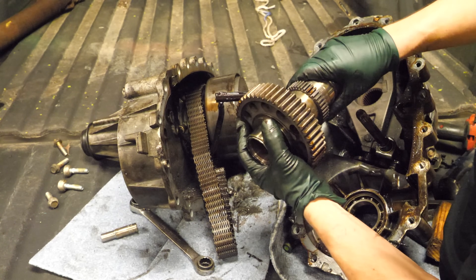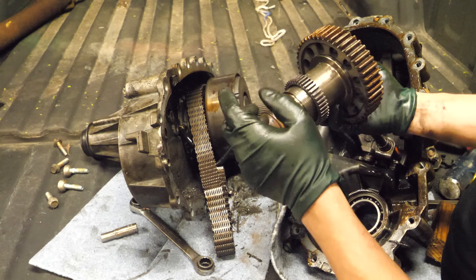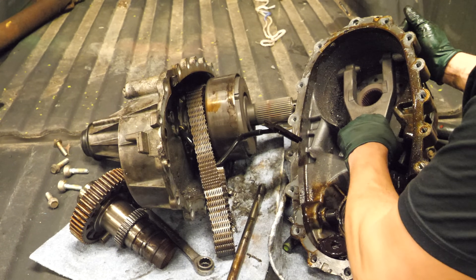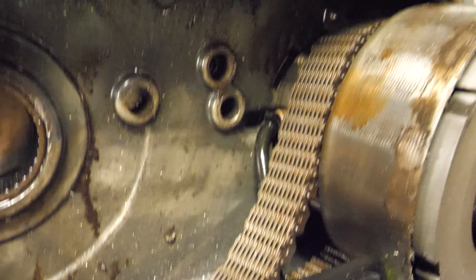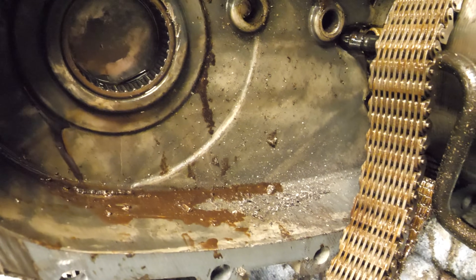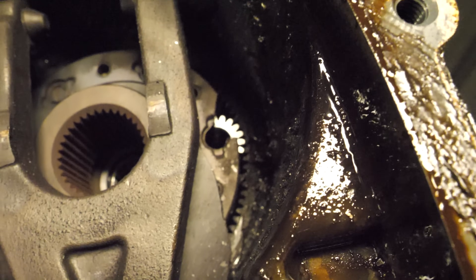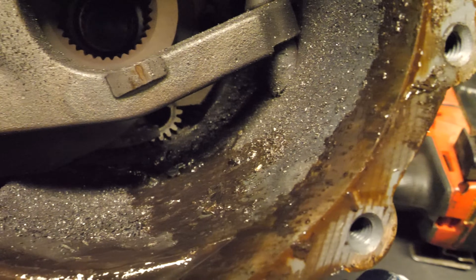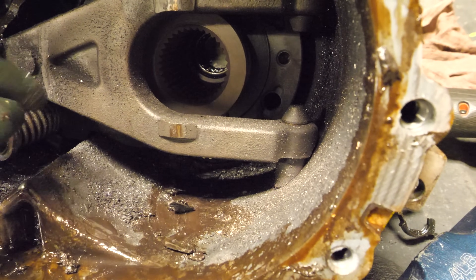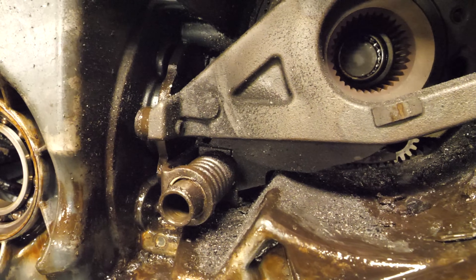There's the magnet. Here's the front drive. Normally I always hear of the chain failing or wearing through, but I don't know how you mess that chain up. There's so much metal in here — we're just pulling parts out. Check out all the shavings in here. That's a lot, but it's nothing compared to the other side. Look at that chunky stuff — it smells like burned clutch, rust, and fire. Not like campfire-that's-awesome, but more like something's-terrible-run-the-other-way kind of fire.